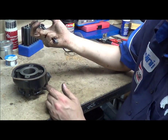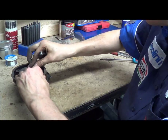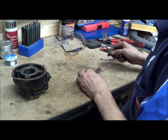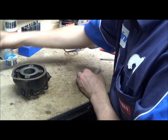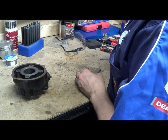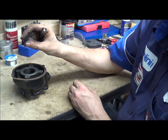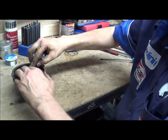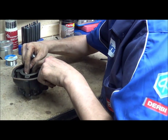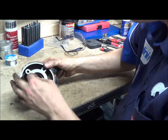But how do we measure this? If I had a piston I'd show you the proper way, but you can just slot your ring in, just like that. Then you find something of a certain depth — a nut or something like that — to push the ring down. Sometimes you can skirt around the entire piston without scratching the bore, using like a ten millimetre nut. Basically, the ring has to be sat flush all the way around.